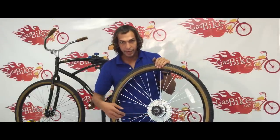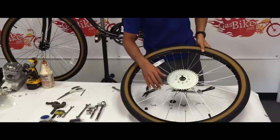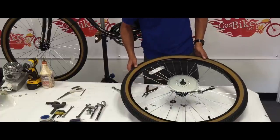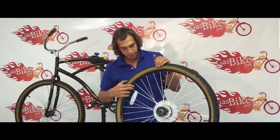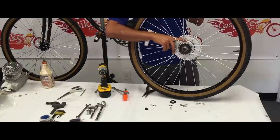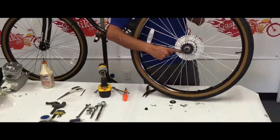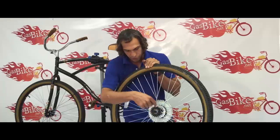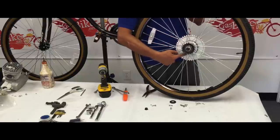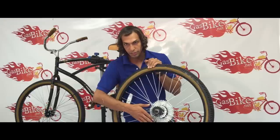As you can see, I finished putting all the hardware on by hand. Now you need to make sure that the sprocket is centered exactly in the middle of the axle. That looks about perfect, so now I'm going to start tightening. When you want to tighten, you always want to tighten the center bolt that's in between the side bolts on this half-moon piece of metal. That way it evenly distributes the force. So you want to tighten this one, then this middle one, and then this middle one. Once you have those three tightened, you're going to move one forward, one ahead, and one ahead of the one you just tightened, and so on. That way you have evenly distributed force holding it down, and not just a lot on one side of the sprocket and nothing on the other.